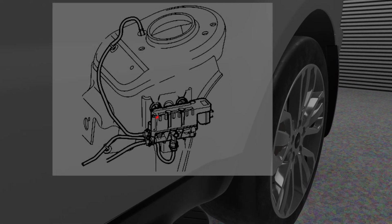It's a combination of 3 computer-controlled solenoid valves, and these valves, when open, allow pressurized air to enter either the left spring, the right spring, or for air to equalize between the springs. If the proximal system is depressurized, opening the valves allows air to flow back to the middle valve block to be vented to the atmosphere, and the springs will drop.